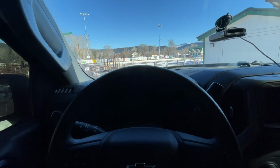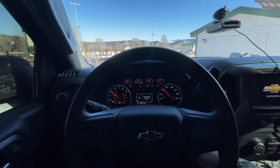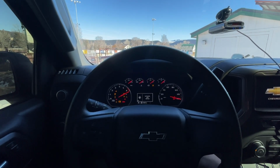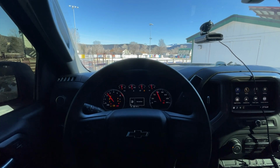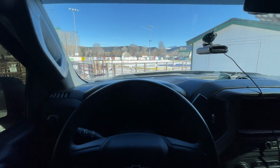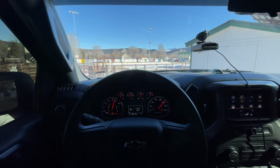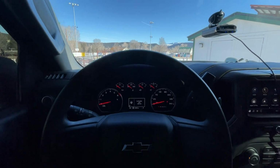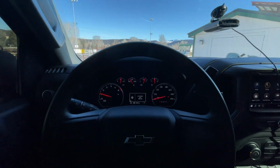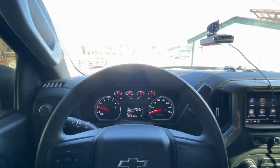All right, y'all, let's get her started up here. Steering assist is reduced. Truck's not starting. Okay, hold up. Alrighty, that's a little disheartening. But if that red box is not completely plugged in, which I thought I had fully plugged in, it won't start and throws all those codes. So I just had to check those connections. Anyway, now we're good. A little alarming.